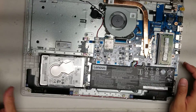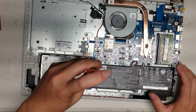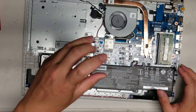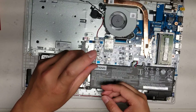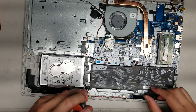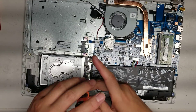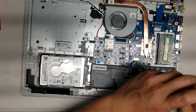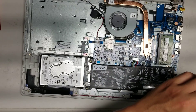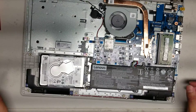I will take out the battery just so I can show you. Usually if you want to mess with other things — especially the screen or LCD cable — you want to disconnect the battery and hold the power button for 15 seconds. I'm not going to be taking all that stuff out, but I'll just be showing you what's underneath. Remember, if you're going to start messing around with stuff, or even just to be safe, hold the power button down for 15 seconds or so after disconnecting the battery.